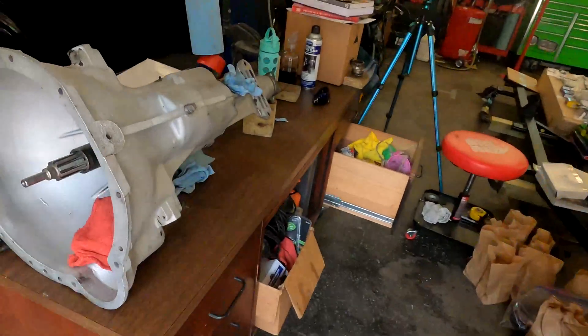Well, that's certainly interesting. I think we might be getting a new transmission. We're back - day two with the transmission. Just finished painting a couple pieces on the suspension. So let me show you what we've got going on here. This is the speedometer drive and it is seized in there really good. We thought maybe we were missing something as far as something holding it in - we're not. It's just one set screw. We got the set screw out and this is supposed to just slide out, but it's not sliding out. We thought maybe it was threaded in - it's not. We came across at least one other person online that has found this problem and cursed about it. So we have used the Jim Vine special sauce, which is the 50% mixture of acetone and automatic transmission fluid, because we got a little bit of lift on it. Hopefully that got down in there to penetrate it, and I'm just going to bang and pry on it and see if I can get this thing out.